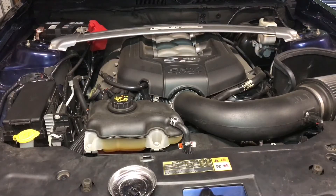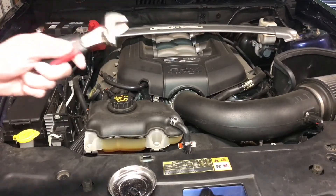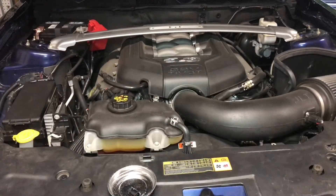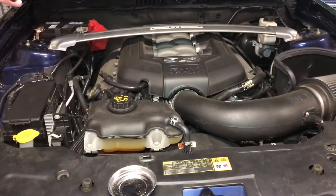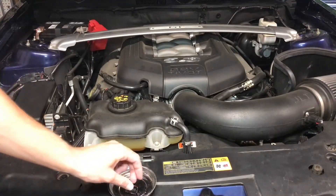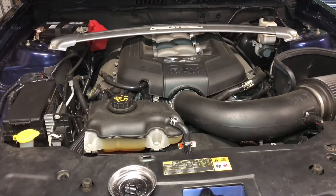The required tools we're gonna need for this job are an adjustable crescent wrench, a 12 millimeter socket to remove the strut tower brace, a 5/8 spark plug socket, an adjustable wrench, and preferably a torque wrench as well to make sure those spark plugs are seated properly.